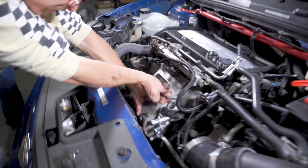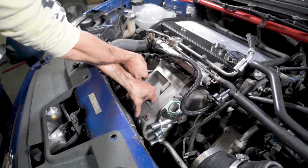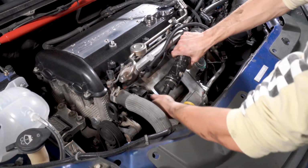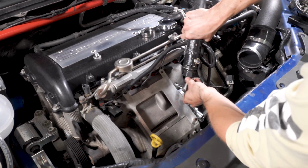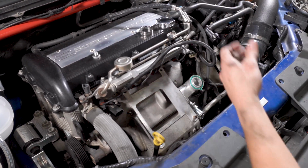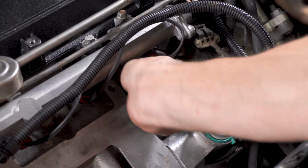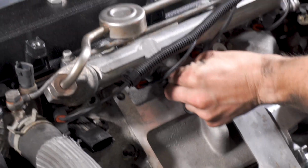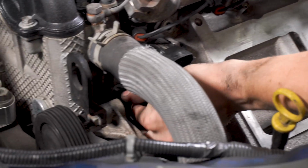So you're going to start with your studs. Get those hand threaded in. There you go. Get it started. Another 10 mil, started here by hand. You have to make sure that you do the 15 mil down at the bottom last.